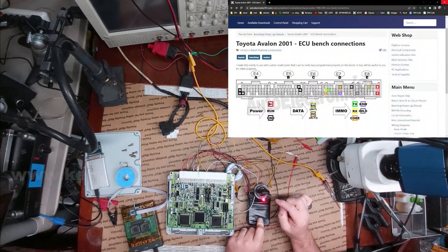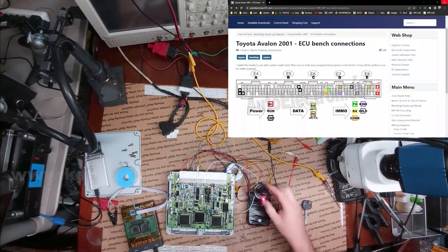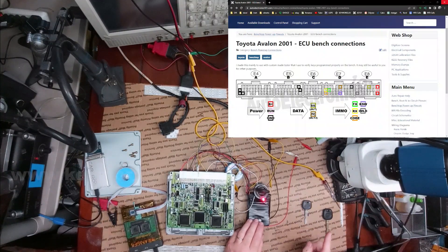I'm not sure it's been a full minute, but let's try it. Now I'm going to take the key out of the ignition switch and take my second master. It's very important that you save the valet for third, so I'm going to make sure I get my second master. I'm going to simulate it going into the switch — again, I'm not turning it, I'm just inserting it — and we're going to wait for another minute. It's solid still, so everything is good with the key. It likes the chip; it just has to take a minute to learn it.